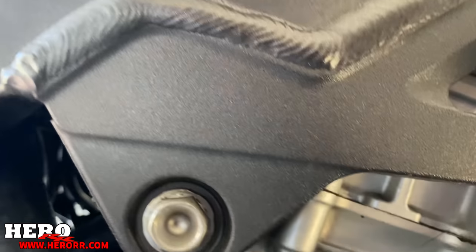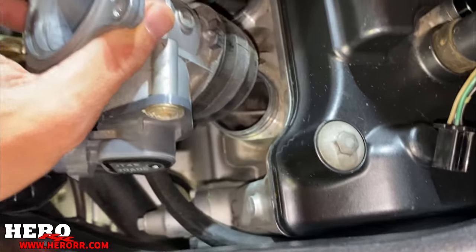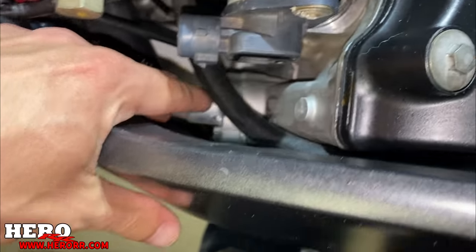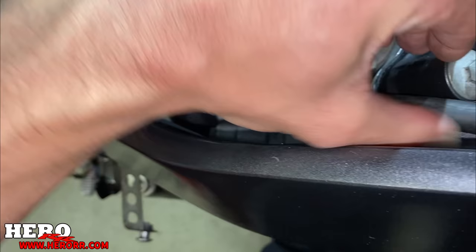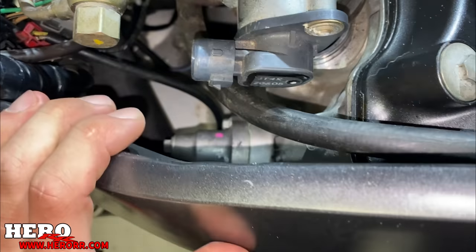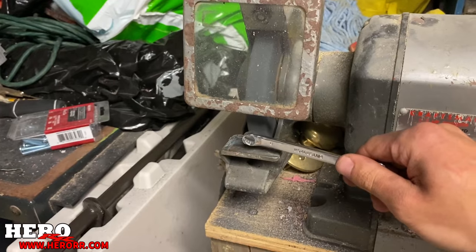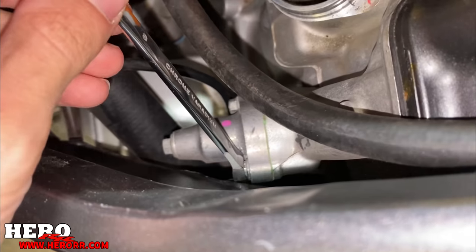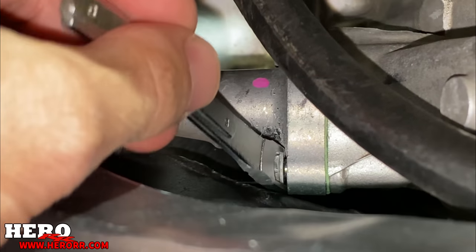So after hearing that my engine is making a weird noise, I decided to try one more thing. I went ahead and ordered a brand new cam chain tensioner. Now if you guys don't know, doing a cam chain tensioner on a 954 is an absolute nightmare — just watch the footage and you'll see. So now I have these throttle bodies completely unbolted and moved over a little bit so I can get access. I moved the wiring harness out of the way and moved a few hoses out of the way. The clearance from the bolt to the frame is incredibly tight — a regular 8mm wrench just won't fit. So I had to improvise with a shaved-down wrench practically to nothing. This is hands down the most difficult thing I've ever done on a motorcycle.